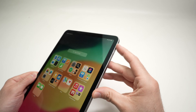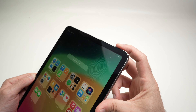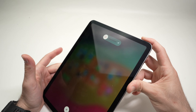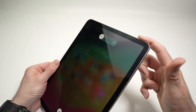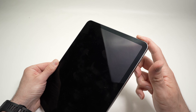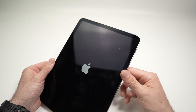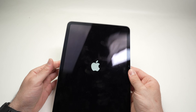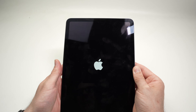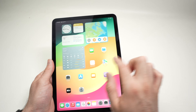So let's do it. I'll press once on volume up, once on volume down, and then I'll keep pressing this top button. And no matter what appears on the screen, do not release that top button. I'm keeping it pressed until I see the Apple logo. Okay, Apple logo — I can now release my finger and just wait about 12 seconds. The iPad will reboot itself and hopefully after that you'll be able to use the touch screen the way it's designed to be.